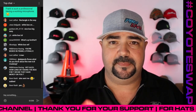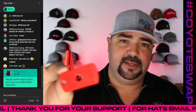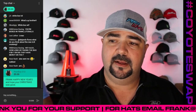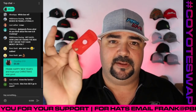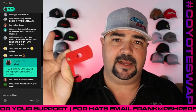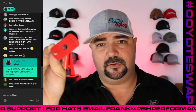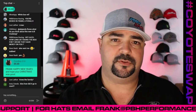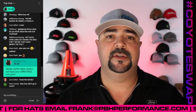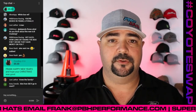PSA from PBH: this is a clocking tool. If you got this in your PBH Speed Drive, please use it — it is a tool. It is not a chiclet, it's not something to keep your parts from rotting during shipping, it's not a keychain. This is a tool to relocate your tensioner. We continue to get calls where guys say the tensioner is hitting the power steering pump. Read the instructions, which are on our website and totally free. Email info@pbhperformance.com if you need them.